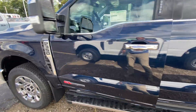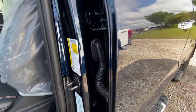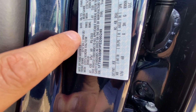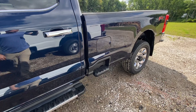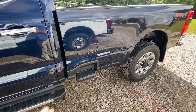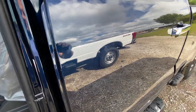Being that this truck is an F-350, you get the higher GVW. Here's the part that surprised me: when you go with a long bed diesel, it jumps the GVW from 12,000 to 12,400 pounds. The front axle rating is 5,990 and the rear is 7,230. So you'd say you have 400 pounds more payload capacity with a long bed than the standard short box — but you've also got the extra weight from the longer frame and bed.